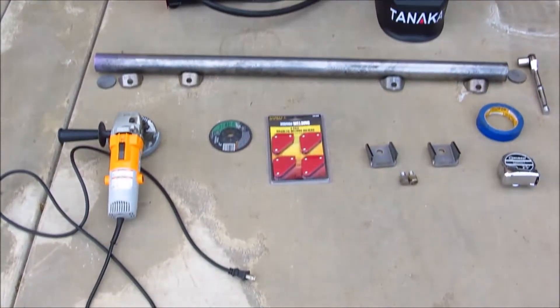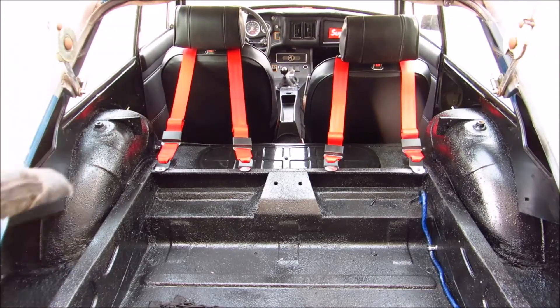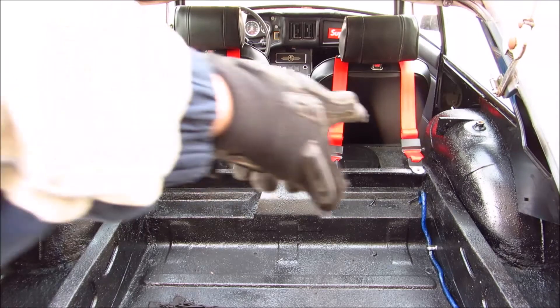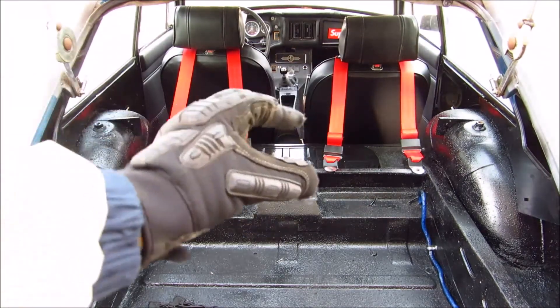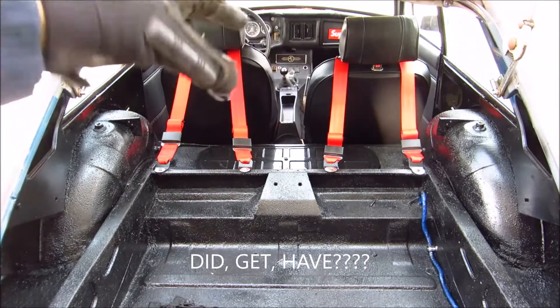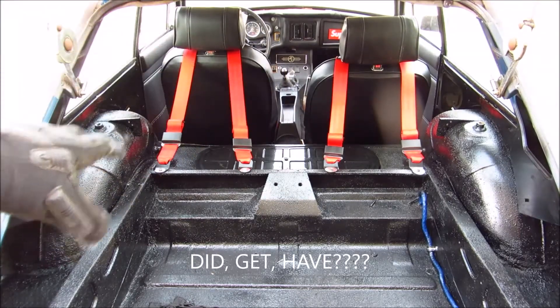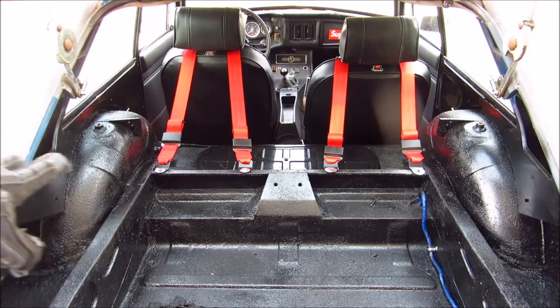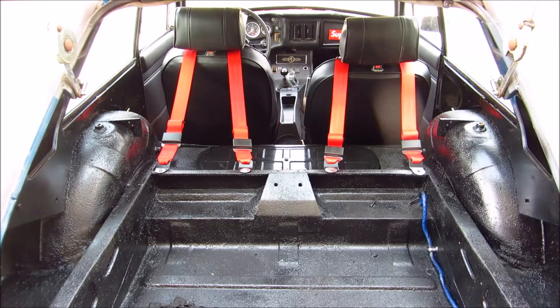Those are the simple things that you need. If you take a look at the back of my car, my harnesses are mounted to this little rail thing that isn't very strong. If I did have an impact, it would bend that little tab up and it wouldn't be very secure. So what I want to do is move those mounting points onto the bar I just showed you.